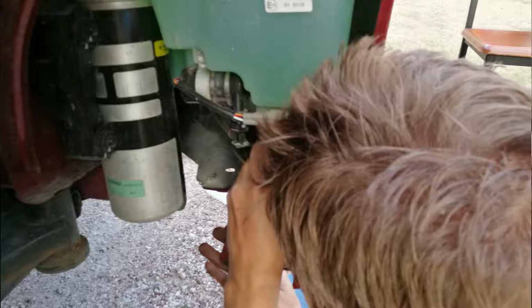But since there was a crack in the glass due to stone chipping, we had to take the whole fog light out, and it was like 105, 110 euros, something like that, was the cost of the fog light. It included the bulbs also, so it's complete. But we had to fiddle around for a decent amount of time before we realized that it's probably going to be easier to just pull the wheel off and pull off the whole inside cover of the wheel arch. After doing that, it was like a 15-20 minute job, because the space inside here, as you can probably see, is decently limited.